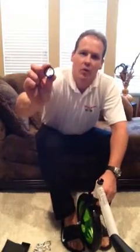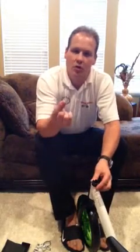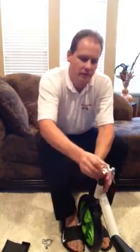Then take your big washer again, with the smaller opening down this time and the larger opening up, and slide that on the tube and push it into the frame. Take your smaller washer and place that on the tube as well — that's the spacer. Then take your quick release. There's an opening, and that opening goes towards the back of the bike. Undo the crank — this is called a crank. There's a little flange inside that won't let you put the quick release onto the tubing the wrong way. It goes on the right way with the opening to the back of the bike.